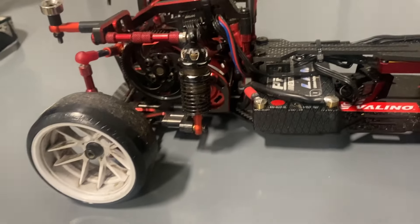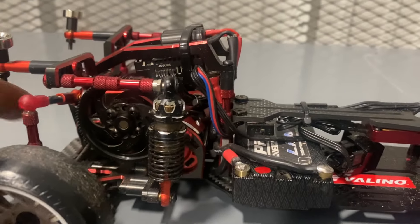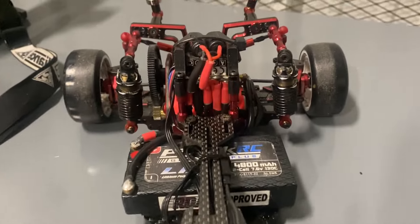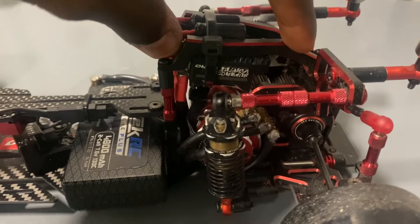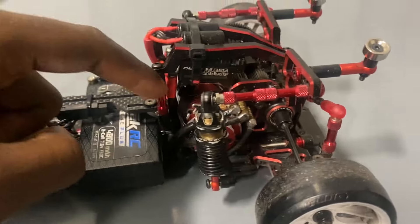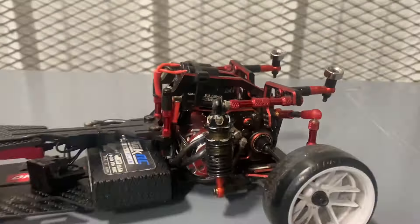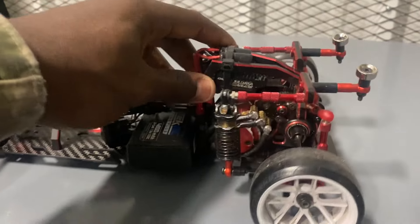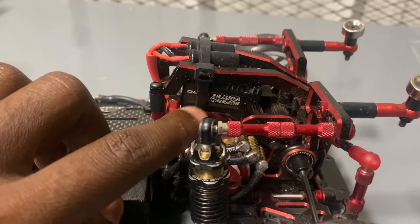I did a lot of things different, so it's not your normal Unicon 01. All the spacers and everything make it so unique. I put spacers here — normally this piece would be rotated the other way, so this piece is rotated around 180 degrees. Without that, it would not give me enough clearance to have the motor and ESC on top of each other. That's another inspiration from the Rhino Racing Shark that I traded a while back.